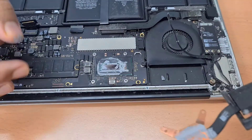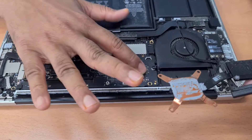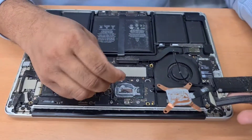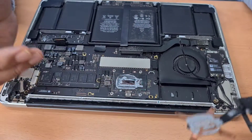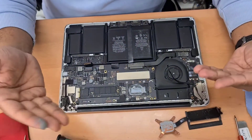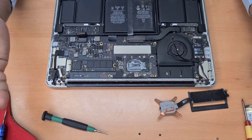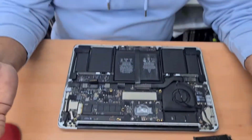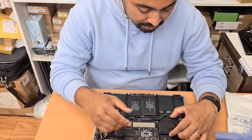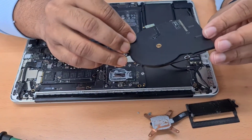As you can see, this machine definitely has overheating issues. It's completely dried — the thermal paste doesn't help at all to transfer the temperature from the chip to the heat sink. So probably that's the reason it gives the chime and nothing comes on the display, then turns off. Somebody could say it could be SMC or flex, yes — so let's try and see. This fan is definitely not working. It could be a connector issue or the fan itself, but I have the replacement anyway.